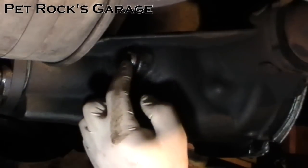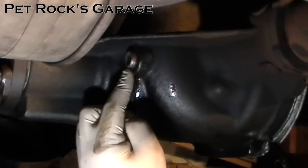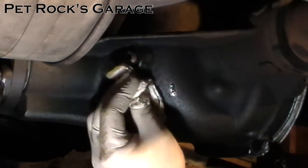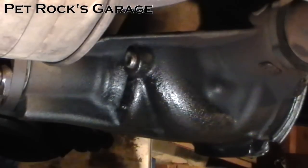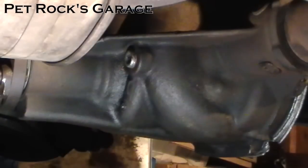This is a tapered bolt, so it's okay that there's a little bit of the bolt sticking out — that's actually normal. Now clean up any oil. It's also a good idea to bathe the area in brake cleaner so that any oil leaks that may occur can be easily detected. So that's pretty much it. I hope this video helped you out — if you have any questions, comments, or concerns please leave them in the comments section below, and if you like this video and would like to see more like it, please click the subscribe button.